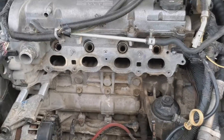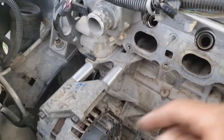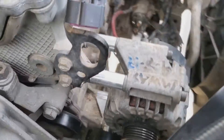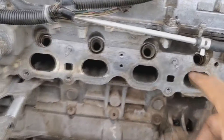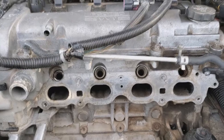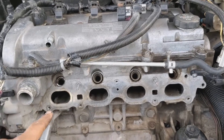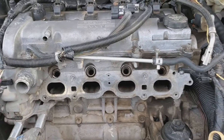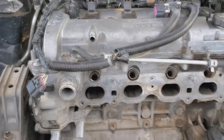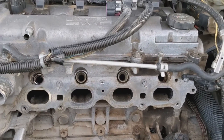We're on a different day, continuing the transformation on the 2.2 LAP. I've gone ahead and removed the intake manifold as well as installed the spacers for the alternator and the lower idler spacer pulley needed for the supercharger kit. I also cleaned up the intake manifold mounting on the head because it was a bit dirty — always make sure the mounting surface is clean, because if not you won't make a complete seal and you'll have dirt and debris trapped in between.